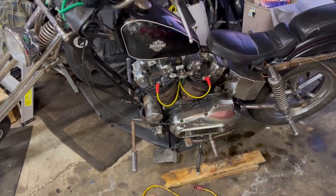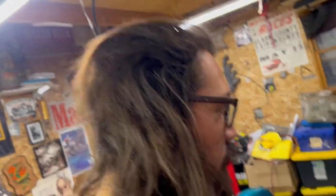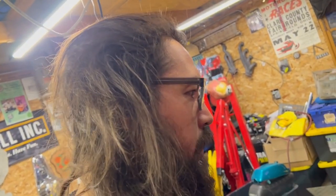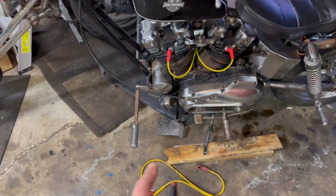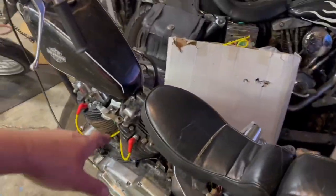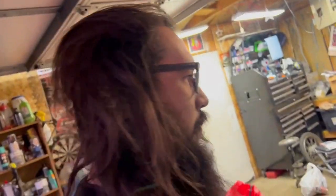She likes that. I didn't see any of the fuel getting sprayed out. I looked through the bore and didn't see any fuel getting poured — like the needle was stuck the other day. I didn't see any of those effects; it didn't look like fuel was pouring into the intake. That's helped quite a bit. I just ran the float bowl completely dry. We'll try this again tomorrow — we've got a couple days of 60 degrees coming pretty much the rest of the week.